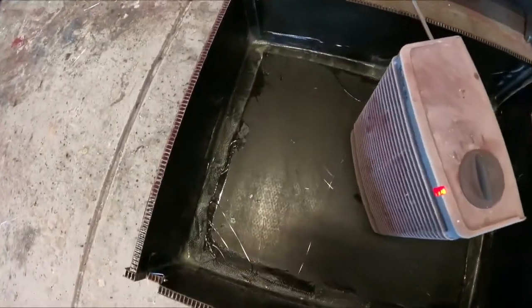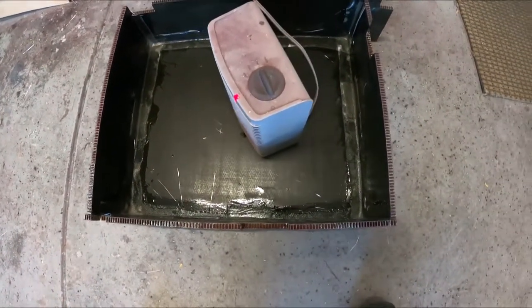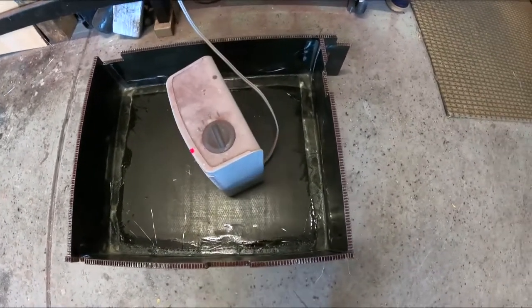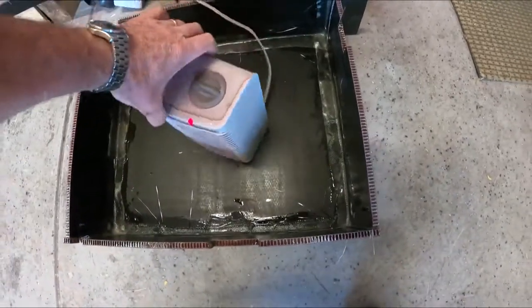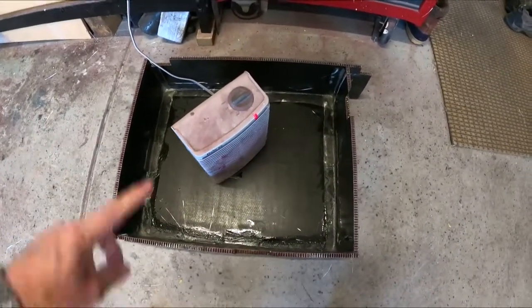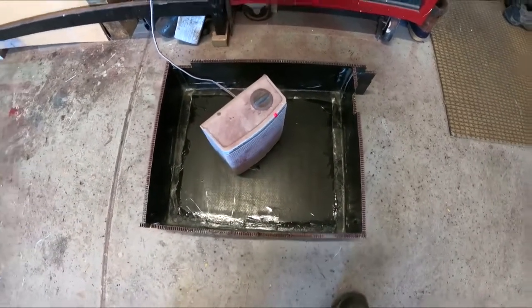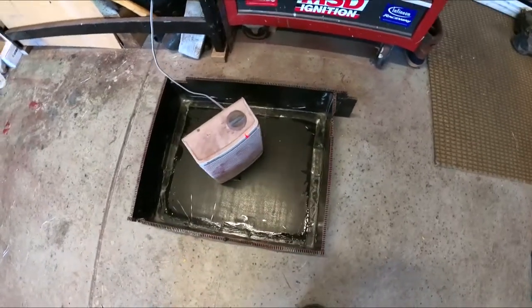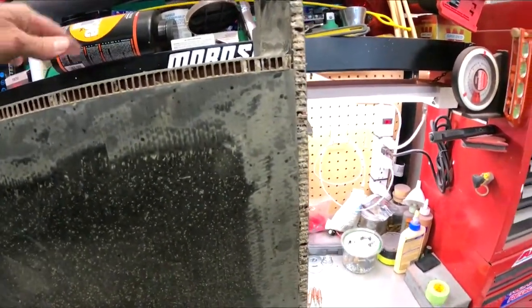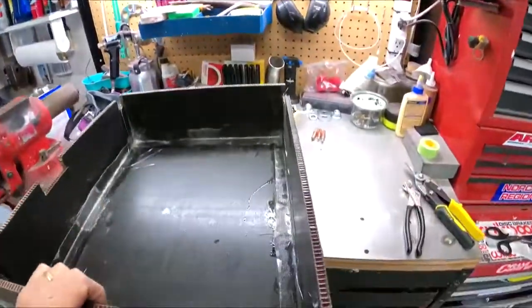Made more progress on our box. You can see it's out of the car now — it's all glassed up. I've got the heater going inside the box. It's in the low 50s and the epoxy just doesn't want to set up that quick. So I've got the heater going on low, just enough to pull the heat out, and I just keep moving it around to keep the heat in the box. Once this is dried, I'll flip it over, glass the outer edges, and then we can finish the inside with carpet or something. A little different than aluminum — better? Worse? I don't know, just different. So I've got the box all built — glassed up on the inside and just a small bit on the outside. I've scuffed the entire area so I can lay up more glass around the edge to make this thing really strong.